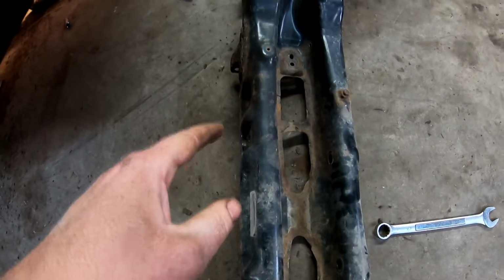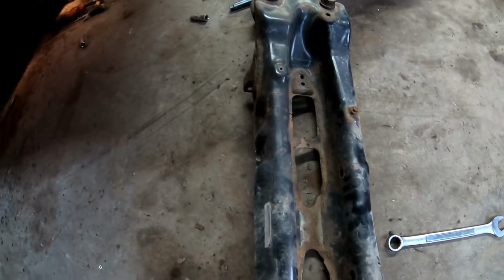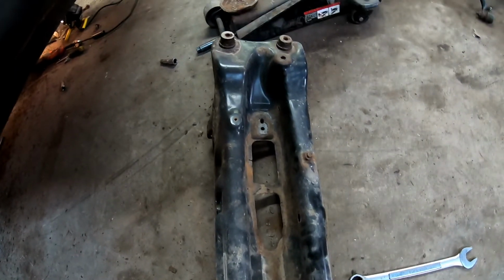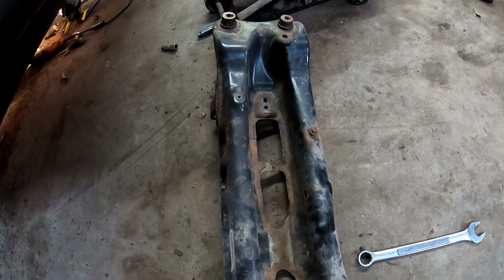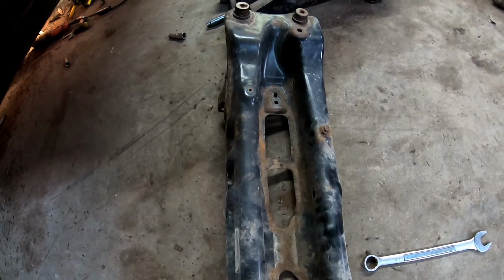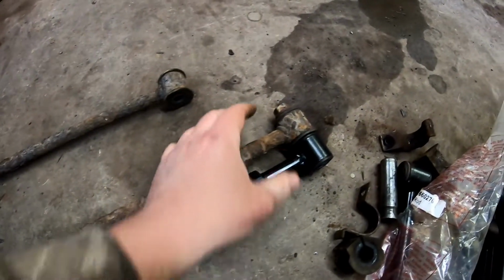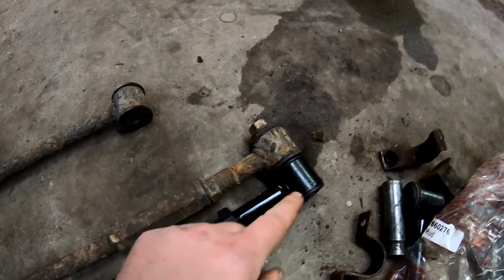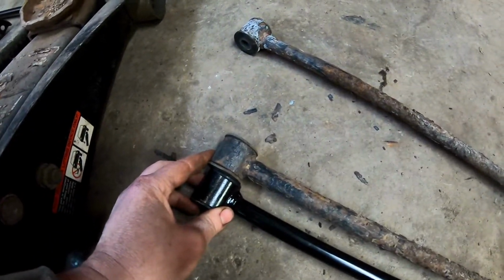I'm going to go ahead now and put the front arms in. They're the non-adjustable ones. And then I'm going to take my adjustable arms and match them exactly the same length with the ones I took out, and then I will put those ones back in. Okay, how I'm doing this is I put a bolt through and it goes most of the way through both of them. And I can see over here I'm a little short.